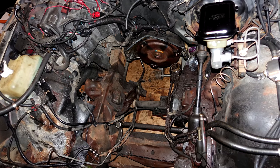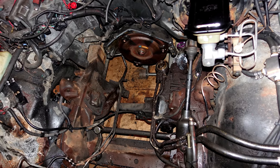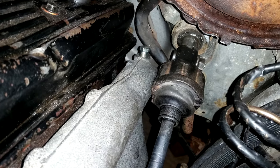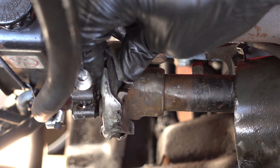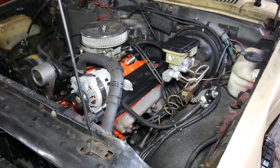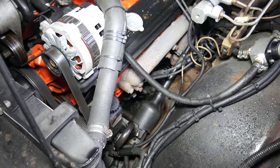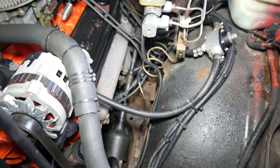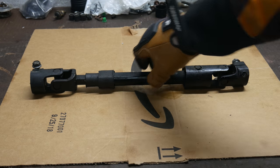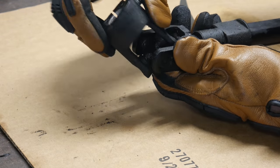This is something I'd read about and wanted to do since even before I owned the truck, I think. The factory S10 steering shaft has a U-joint where it meets the steering column, but a rag joint, which is basically rubber with fiber reinforcing similar to that found on tires, which maybe was okay back in 1988 when this truck was made, but now that it's been 30 years, that original piece of rubber probably has more flex than it should. So, we'll replace the entire intermediate shaft with one from a Jeep that has two solid U-joints.